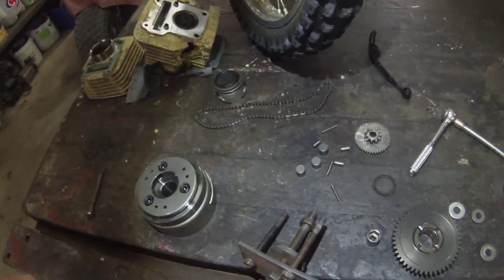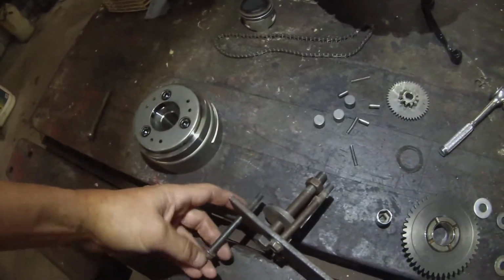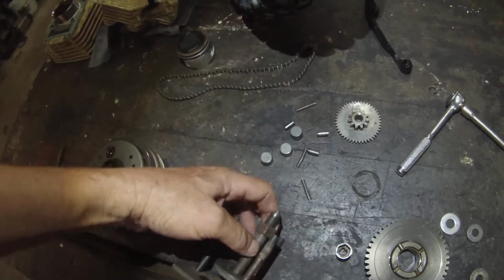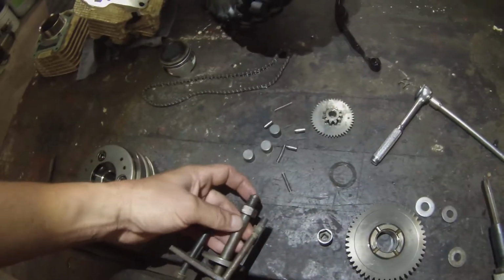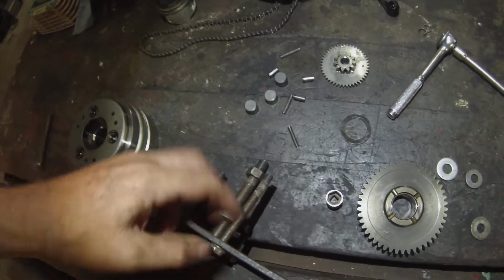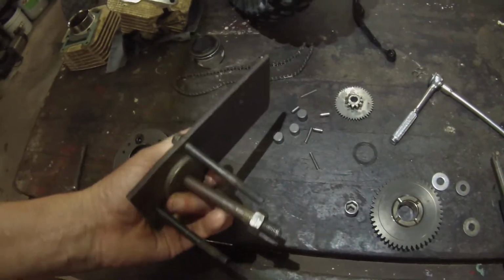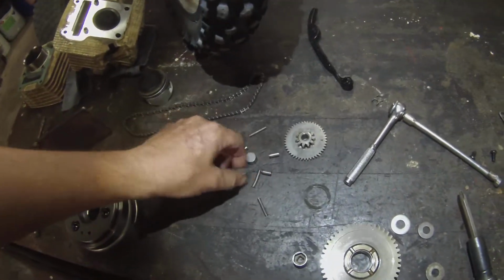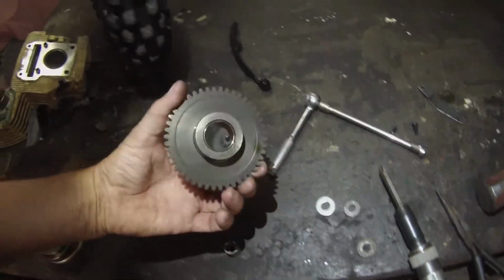And in the end I made this just more bulletproof. I went and got my own high tensile bolts, the 8mm, this big fat one here with a UNF fine thread on it, put a taper on it with the lathe, and put an extra plate on because this plate here was buckling out of shape, and that did it. It came off with a right bang, and straight away all these locking bolts for the starter motor system all fell on the floor. It all just fell to bits.